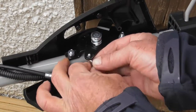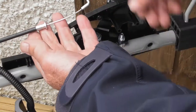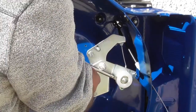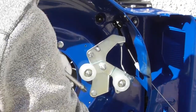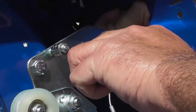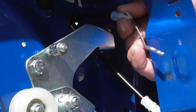To remove this cable I first need to disconnect it from the handlebar end. I'll remove the end of the cable and give myself some slack by unwrapping the cable completely from the handlebar. Using a bar from my socket set I can take the tension off the cable and remove the end of the cable from the little hole. Then to remove the retaining clip — there are two plastic white wings on the end of the cable retainer — turn it around, squeeze them in, and simply pop the cable out of its location so it feeds out through the top of the deck.